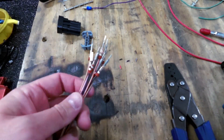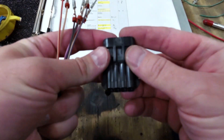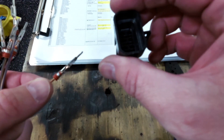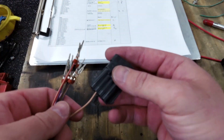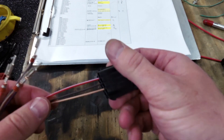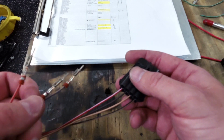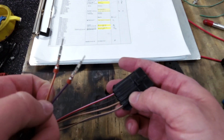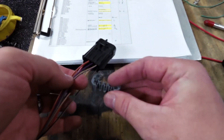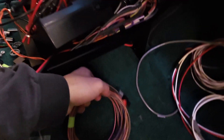I've got all seven of these done. Next up, there's my spreadsheet showing the layout of the connector — this is where it does matter. I went A, B, C, D. So it's just a matter of getting everything lined up and then you plug them in. Same thing on the other side with the lettering. And then last up we've got the TPA — just line it in between, line all the wires up, and click it on.